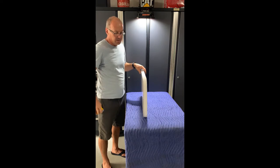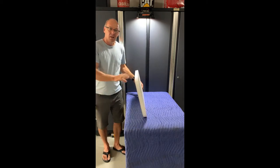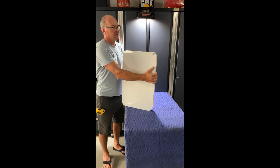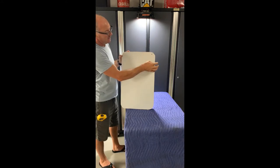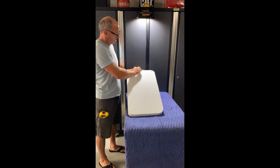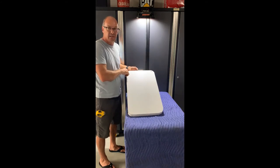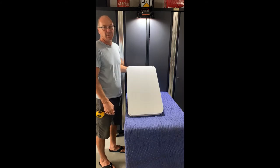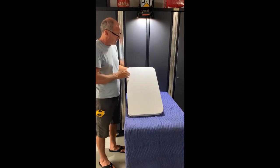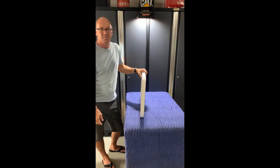To cut it, it's quite easy — if you use a metal blade on your jigsaw it will cut quite fast and easily. I drilled a half-inch hole to start, as you can see right here, and I traced out the pattern on the door. I drew a box and then formed in the corners with a radius. I marked the outside of the door with pencil lines, made sure it was exactly square with the top of the roof and exactly where I wanted it, and yeah, it cuts really fast and really easy — nothing to be intimidated about.